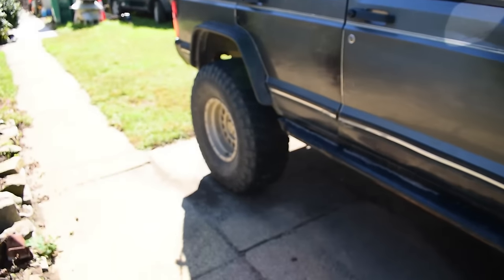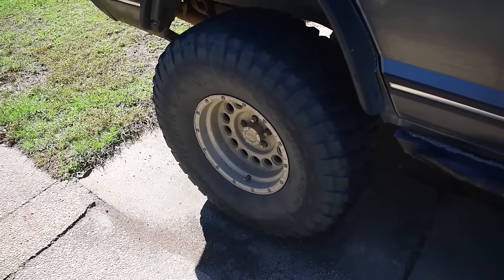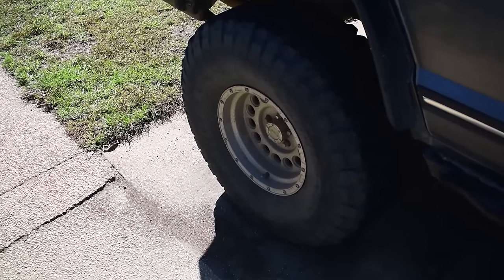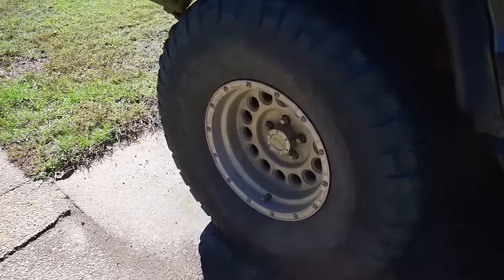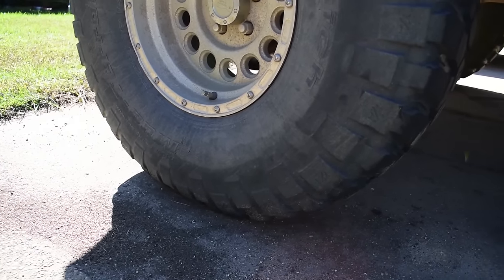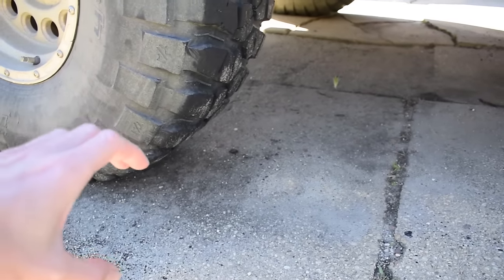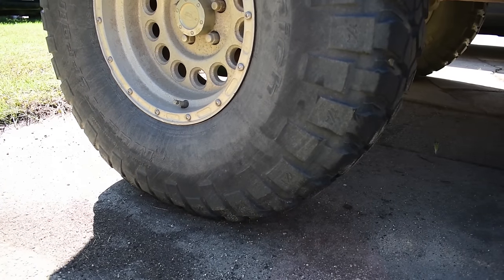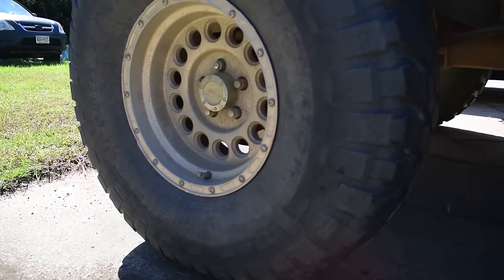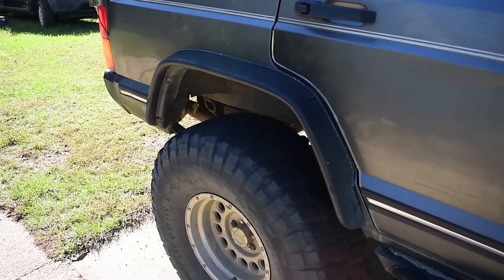When you're on the trail and you need more traction, lowering your PSI is very beneficial for a couple of things. It makes the ride smoother because the rubber has more squishy room — it's kind of like its own little shock absorber. It also gives you a larger footprint because as the tire deflates, more of it contacts the surface, and it helps distort around objects. It's kind of like a hand — it'll grab onto stuff better. So it's good for rocks, mud, and just about everything. And as a side benefit, because it's taking some of the shock load, it helps keep the rest of your truck from wearing out as quickly.